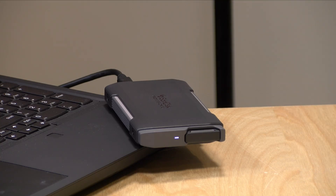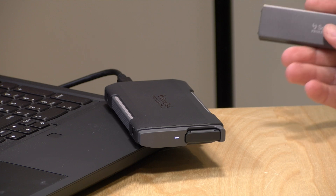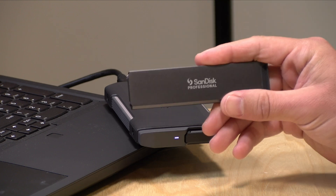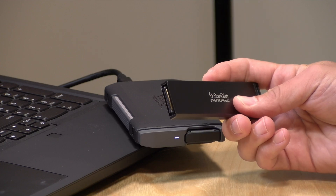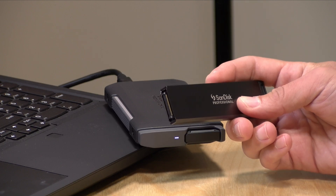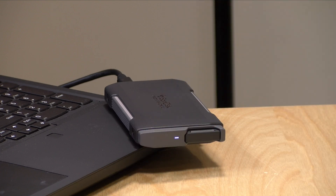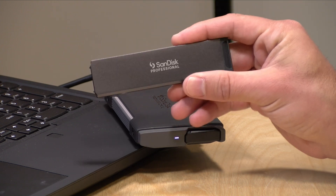If you're looking to pair this with an Xbox Series S or X or a PlayStation 5, know that like other USB external storage, these drives will play older PS4 and Xbox One games, but not new next-generation titles. Those do need faster NVMe storage, and although these drives could deliver that performance, the interface is not compatible in a way those consoles can take advantage of. So this won't get you anywhere further with next-generation titles, even though the capability to go faster is there.